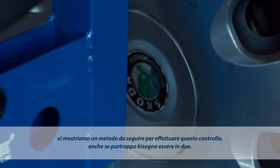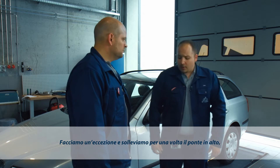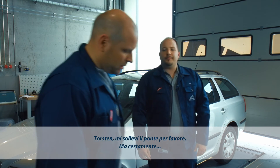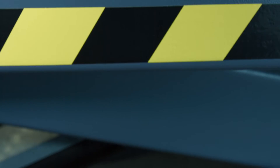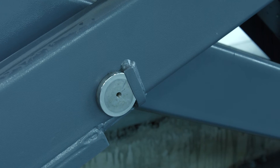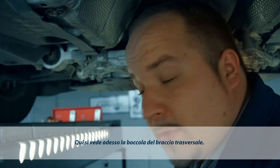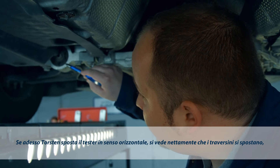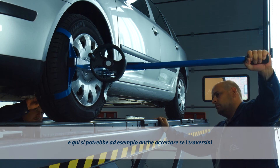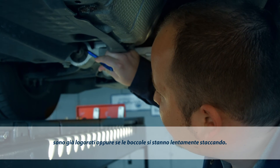So now we'll demonstrate an alternative method which, unfortunately, requires two people to make it work. We'll take the unusual step of lifting the platform to take a look at the control arm bushings from underneath the car. When Torsten is moving the Joint Play Tester horizontally, you can clearly see the bars moving too. Once you're under the car, you can also look out for control arm bars which are already cracked or bushings which are coming loose.